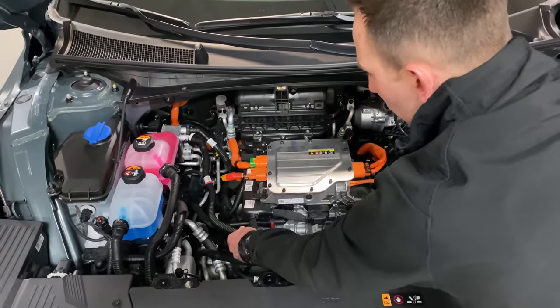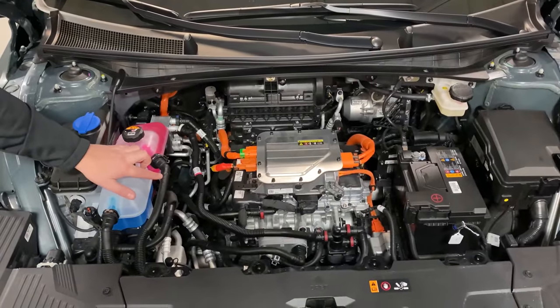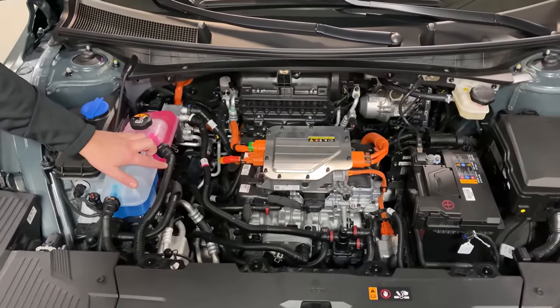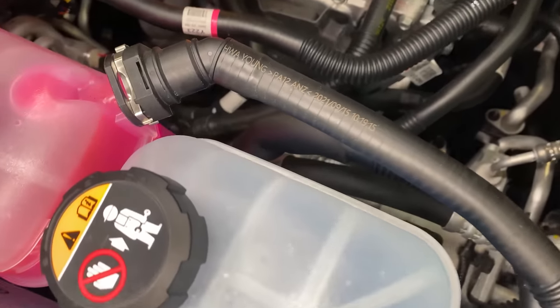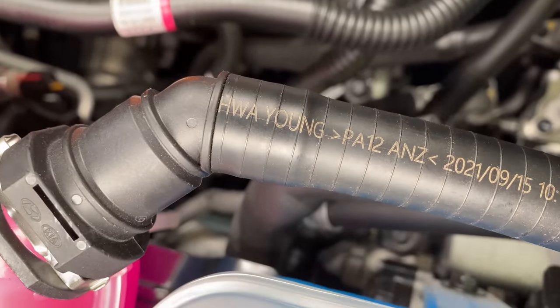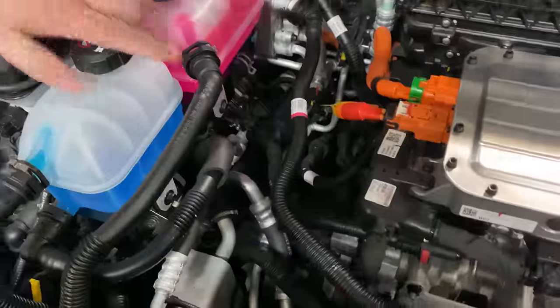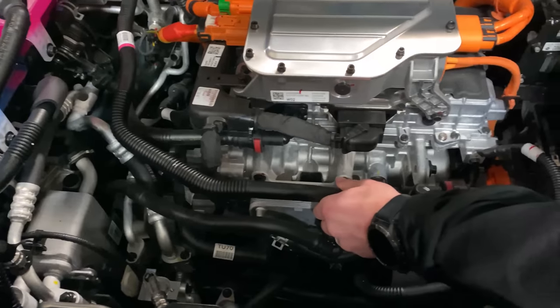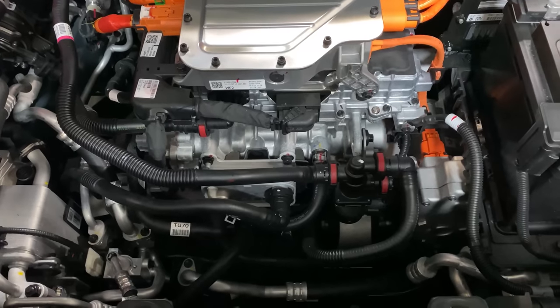These quick connects are molded nylon lines, which are significantly lighter and easier to install. Right here we have the material — PA-12, so they're nylon 12. Each of the tubes is molded onto the connector. It's not a stake, so it's not an actual weld, but it's thermally formed onto the connector.